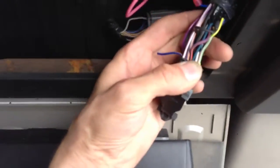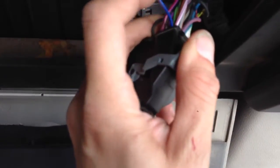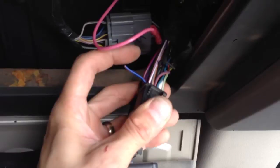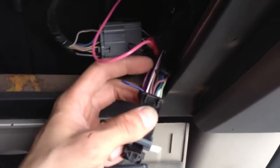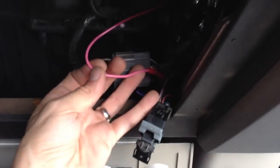Here is where you need to integrate a pink wire for the steering wheel controls. It's a blue wire with an orange stripe. You're basically gonna cut it, and the end going back to the car away from the module is gonna be plugged into your Maestro.